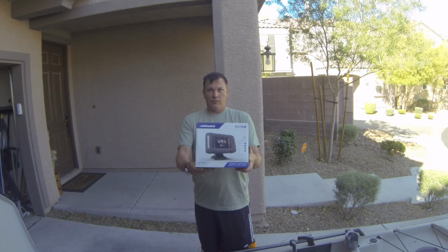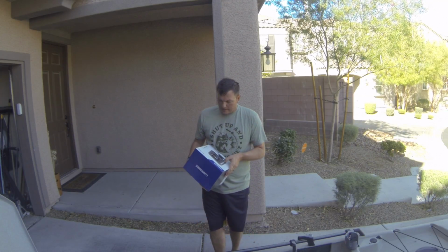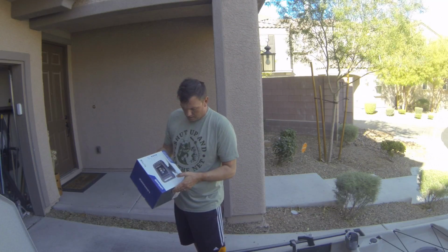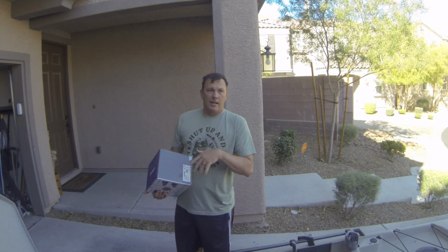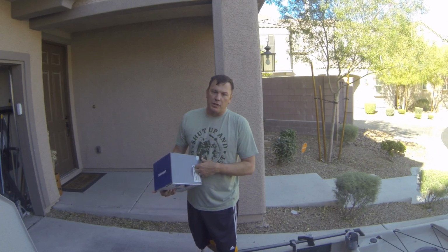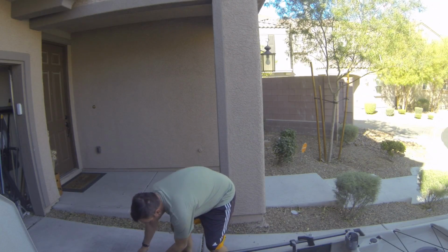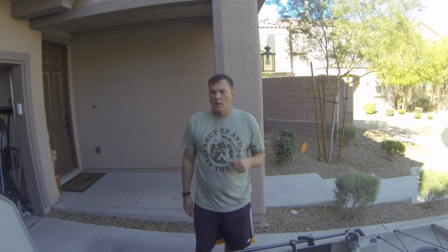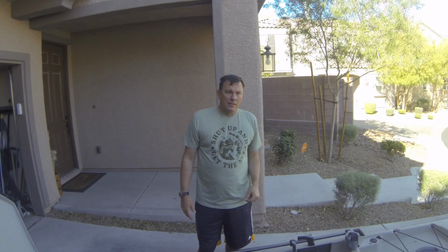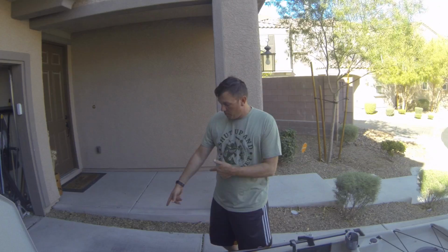And I'm going to be putting this, which is the brand new Lowrance Elite 5 Ti. And this is the version that has the total scan. So I'm getting regular sonar, down imaging, and side imaging as well. Well, I would have just gone with the total scan transducer, but the total scan transducer is not compatible with the Gen 2 HDS 7. So rather than going up to another HDS Gen 3 for a bunch of money, I went with that.